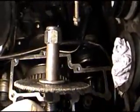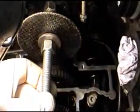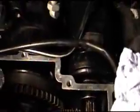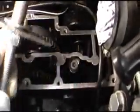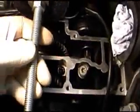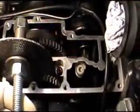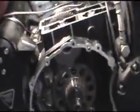And as I said, because that spacer's there and it fits inside the bearing, you slowly push it into the wall, and you just cut. I went a little too far, but you just cut as much as you need. And because it's centered within those two existing bearings, this rod here, it cuts out a perfect shape out of the engine case to get the sprag in. And it's pretty much what we got.